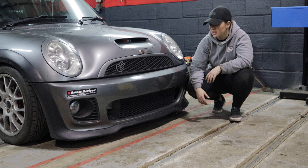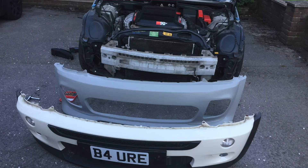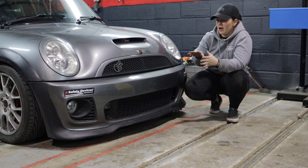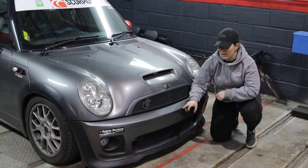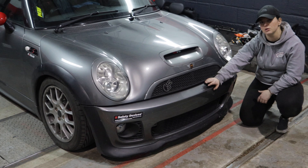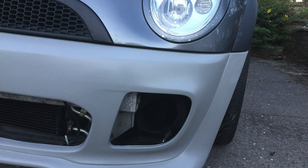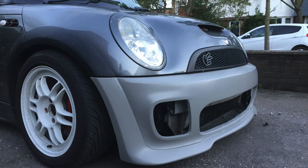One of the cool things that a lot of people don't realise about this bumper is that Richard, when he developed and designed it, had to use parts of an R56 John Cooper Works and parts of an R53 bumper. If you haven't already noticed, this bumper actually uses the top of an R53 bumper — where it's all flat on the top — whereas normally it would have another grille fitted at the bottom. It uses the R53 top section and then the rest is all R56. To make a JCW bumper off an R56 fit one of these, the bumper itself is just too long and takes so much time, effort, and money, so this bumper literally bolts straight on — it's pretty much a perfect fit and really nice and lightweight.